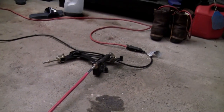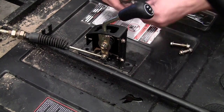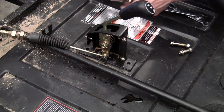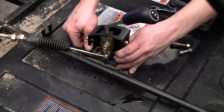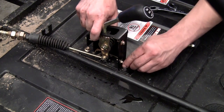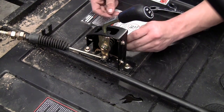I'll go ahead and install the back piece on the engine after. Your shifter right here is going to come with three bolts — one on this side, one on this side, and one on the back end. It's probably easiest to stick all your bolts in first. The last one is a little bit longer on the back side.